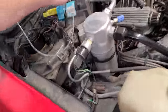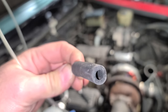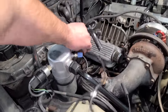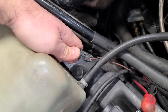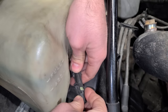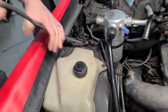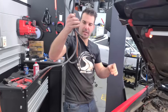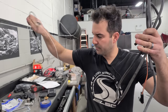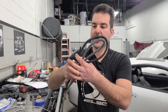What they had going on here was a T-splice in the reference line to the factory MAP sensor for a boost gauge, plus that ghetto vacuum hose connected on the passenger side of the intake. This is all going away. We're going to run one straight line to the MAP sensor so it gets an uninterrupted signal. Luckily they didn't splice into any of the factory harnesses — we can plug the factory connector right back in and eliminate this entire mess. In total we got rid of six potential leak spots — this one kept popping off and removing MAP sensor reference, which is critical. We also removed the open power wires so the Grand National doesn't burn to the ground.